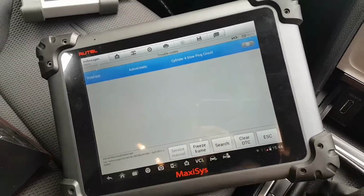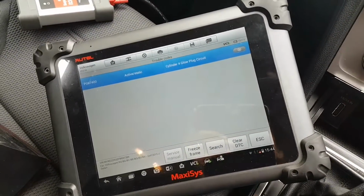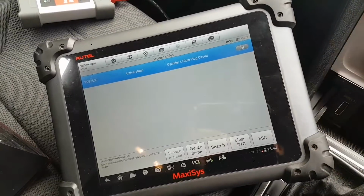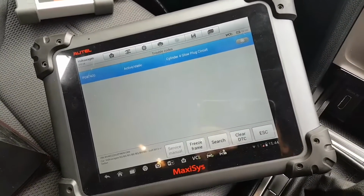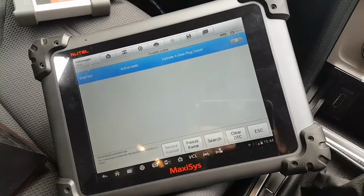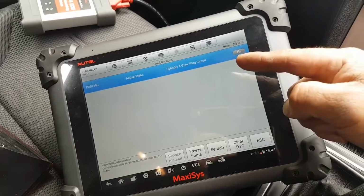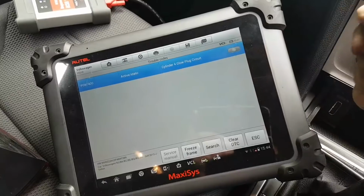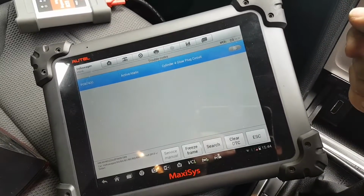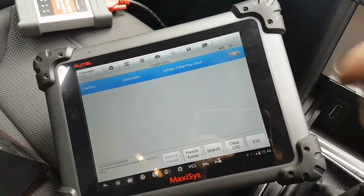There we go. So we activated it. The engine control module detected... I don't even know if these glow plugs are activated by a separate control module, or if it's by the engine ECU itself. But we have activated the glow plugs, and straight away we have a fault for glow plug number 4. So let's get under the bonnet and do a few checks.